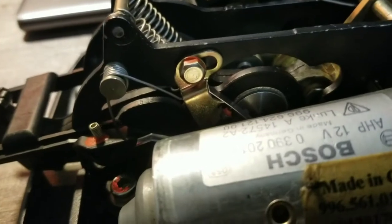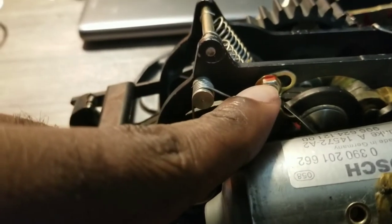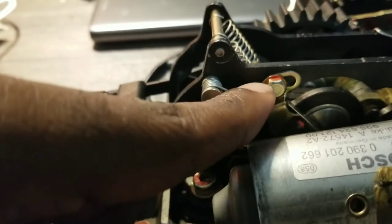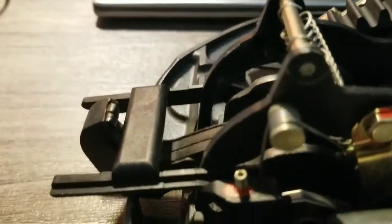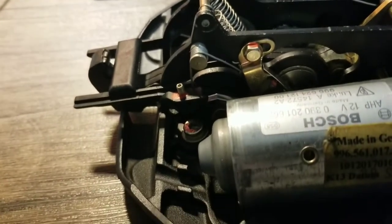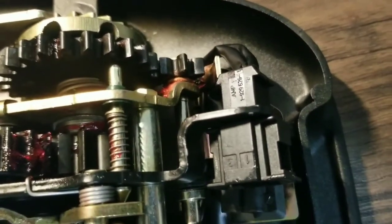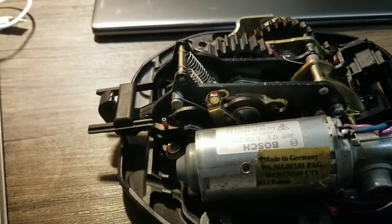But automatically, I know that it doesn't look like it's been replaced because, look, this here is still tying into the O-ring behind it, that coloration, which means it has not changed. Otherwise, this would be rotated off. I don't think anybody's going to match that up. Doesn't look like it's broken. So I don't believe they did anything with the micro switch. Maybe they put some grease over here. Looks like there's some fresh grease, and they thought that would fix it. But definitely the micro switch was not replaced.